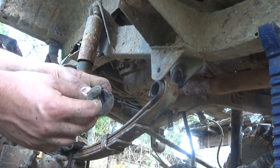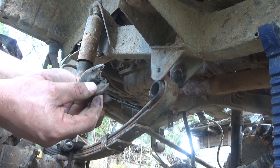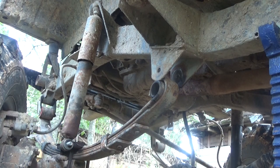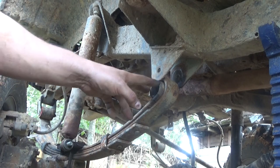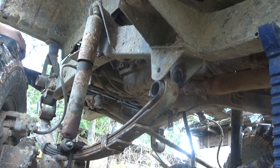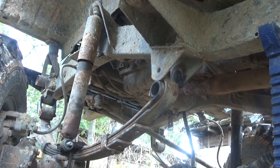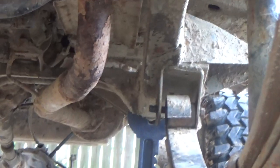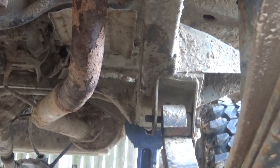It's doing this to all the bushings. The back, the front — all these rubber bushings are just getting torn apart like that within a couple of months. If you were doing a regular one, you could just pop the bushings right back in and put it back together. I'm going to flip the spring back how it's supposed to be and then start back where I left off. I put that bolt back in for safety reasons — once you take the spring loose, the only thing holding it up is the jack stand and you don't want to be under it.